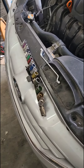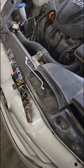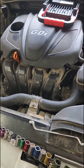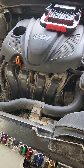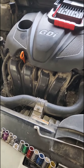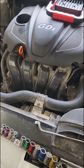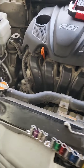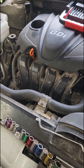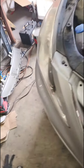So this is what I learned: these Hyundais in particular are prone to have something called an expansion valve get sticky, which would account for the AC being lackluster for the first 30 or 40 minutes you drive the car, and then finally the expansion valve opens up. That actually makes a lot of sense because that's kind of what happened here, and my girlfriend's Hyundai has the same issue.